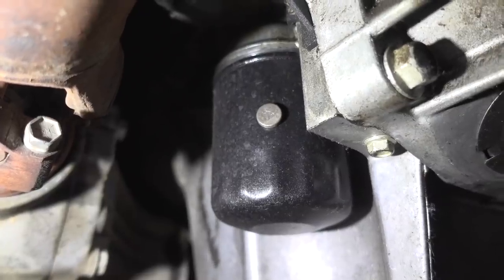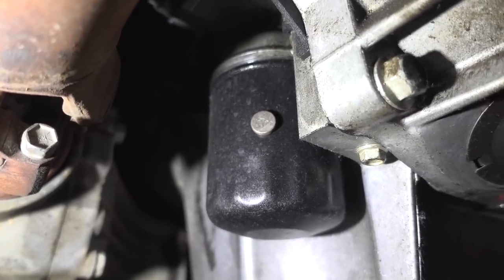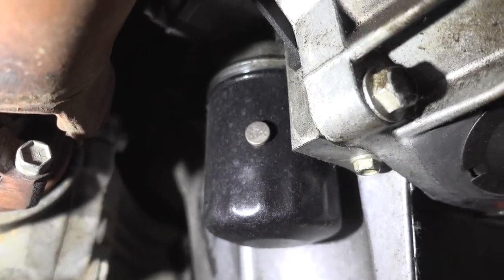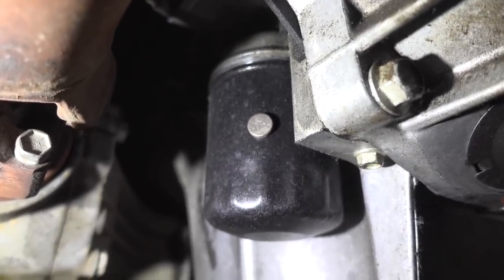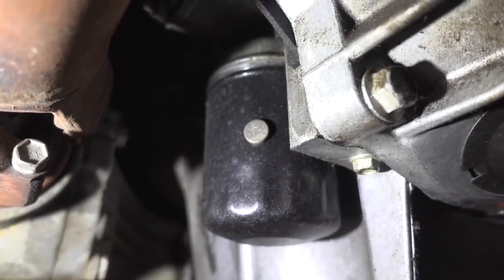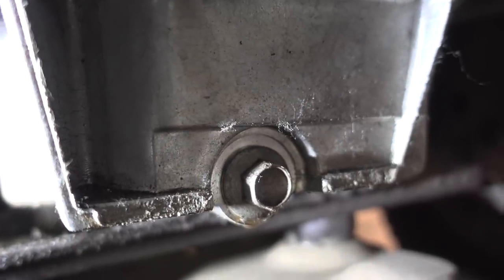Under the car you can see that's my oil filter, and you can see there's a magnet there and the same one on the other side. Those have been there since the last oil change and I'm trying to collect any ferrous material not being caught by the filter media. And there is the oil drain plug — 15 millimeter.